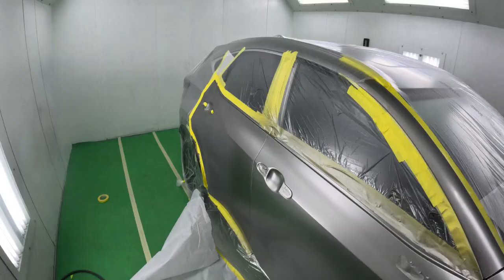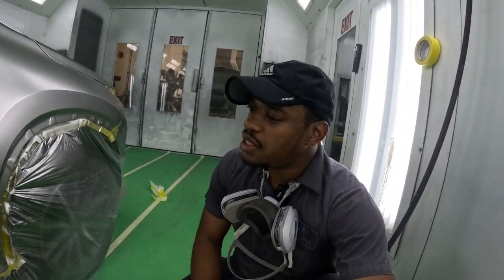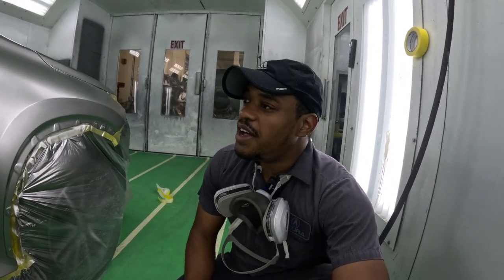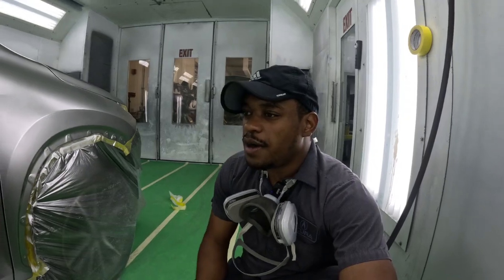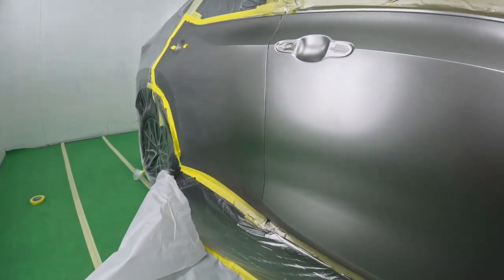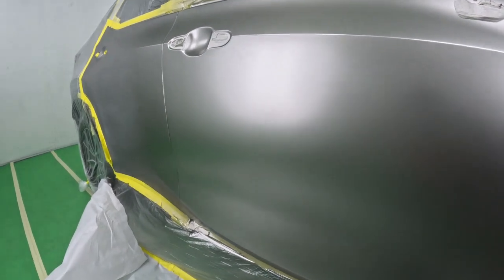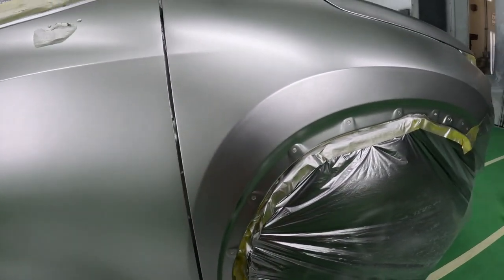You can see when a base coat looks slick. The gun feels great in your hands. It sprays just as smooth as even a DV1. The gun is really good so far. So I'm gonna finish this up. If you notice, the color looks a little too light. So I'm gonna switch the color, add some blending additive on here, and see if we get somewhere better.